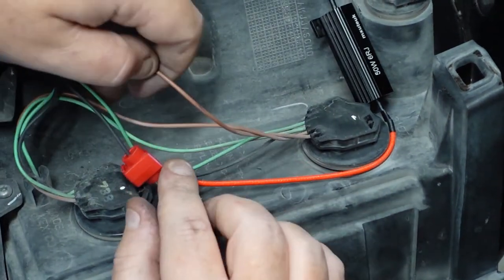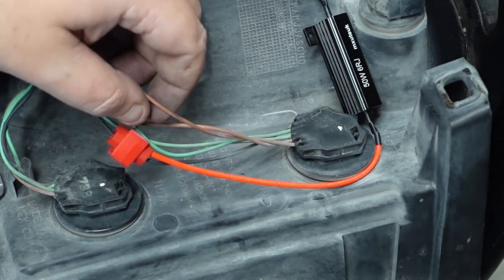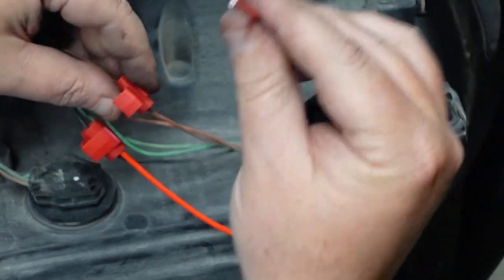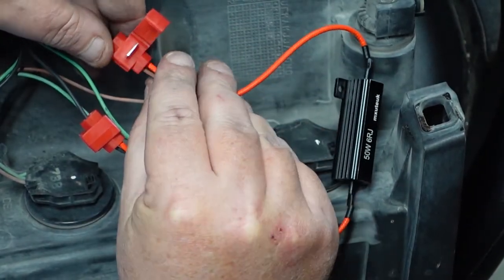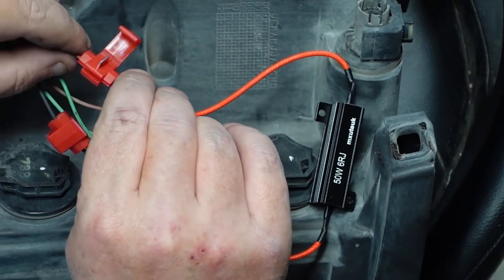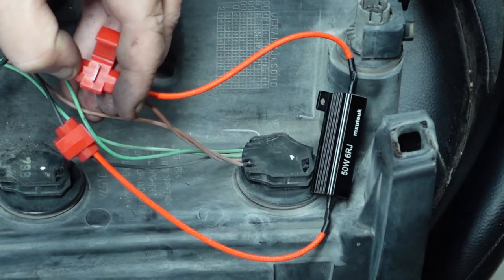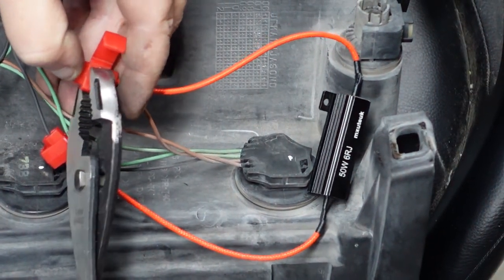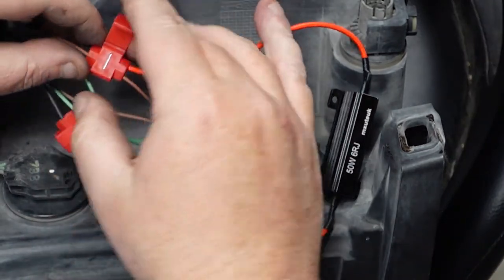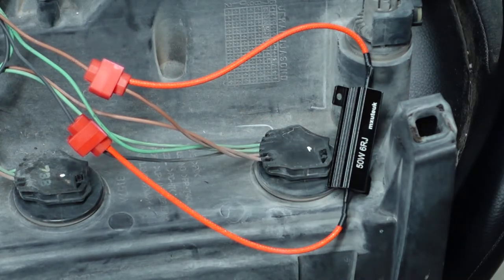Now let's go to our tan wire — here's our tan wire that runs up from the pigtail. We're going to take another one of these and put it on like so. Then we're going to take the other end of our resistor and push it in there. Now we've got both wires on there and ready to go. All we've got to do is crimp this one. Make sure you get it good because you want these connectors to work right. Once again, we'll fold this over — two clicks, click, click. That one's done. Now this bulb has completely got the resistor on it up top here.